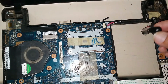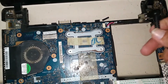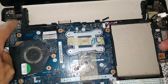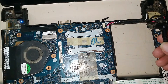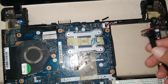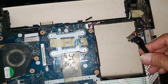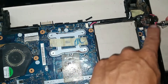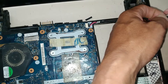That is a sign that I need to check the charging jack and the cables connected to it, to find exactly what the problem is. I repeat the exercise — the computer is working, but when I move the charging jack, the computer turns off. My conclusion is that there is a point in this connection that is failing.